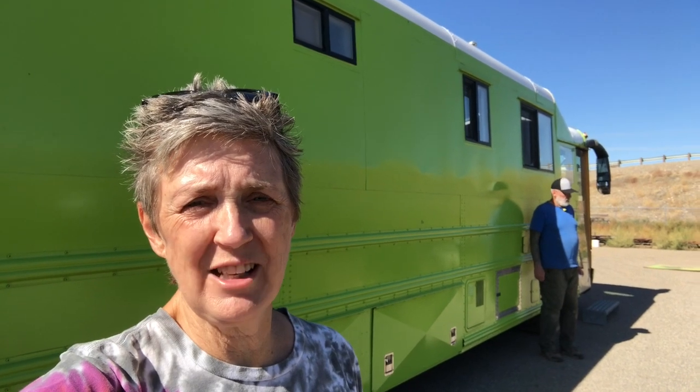Okay guys, it's a new day. We recovered from getting the bus painted on this side, but we did make it, so we are ready to move forward today. I'm going to let Randy bring you up to speed. Okay, what went right, what went wrong? First thing that went wrong: we got some advice early on — don't try to paint the whole thing at one time, paint it in thirds or fourths. So we did that, and that was a mistake for us. It didn't work because now we have a line going down there. We should have gone the whole side.